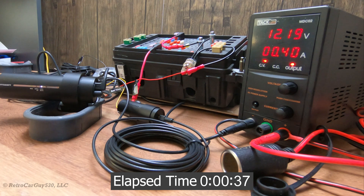Because if you have small dropouts and it comes back up, you don't want it cutting off the camera too soon. As we get close here, you can see that it's drawing between 400 and 450 milliamps with the front, rear, and CM100 LTE device connected to it. We're about to get to the voltage level where it's going to cut off at 12.16. We'll see the lights on the camera begin flashing to show it's about to power down. And there's the indication it's going to power down — we'll hear it announcing the fact and see the amp draw drop to near zero. This does prove that the voltage cutoff feature works, though a little higher than expected.